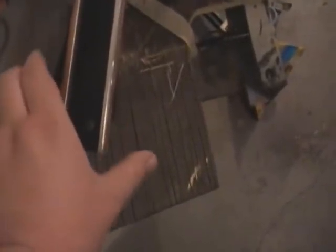Here's my new one - I cut the brackets off the other one, they were riveted on, and I bolted them onto here. I cut the bottom out of this piece of rectangular steel - it's a two by four piece of steel, 53 inches long. When I cut this bit out I noticed it spread apart a little bit, so I'm going to have to weld in a couple of little pieces to pull this back in. I'll clamp it and weld a piece in to hold it straight. I've got some weld-through primer on it because I intend to put a few welds on it just to hold it even better.